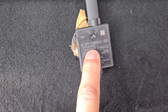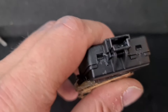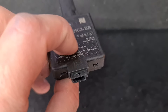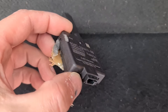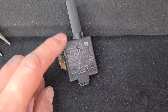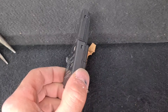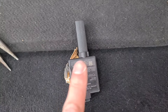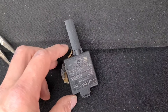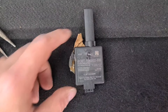This is the one that's relevant to the vehicle. It's quite a generic part — probably about £15 off eBay. You replace that because the terminals inside there corrode away, as you can see. You'd probably be able to clean it off and repair it, but you're obviously susceptible to it happening again. What I suggest you do is replace that part for one that hasn't corroded. In the UK I'm looking at about £100 direct from Ford. Then wrap it in a plastic bag, tape it up, and put it back into the roof liner or wherever it's located in your vehicle to help prevent it doing it again.